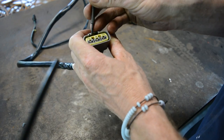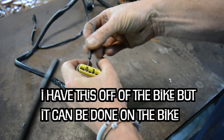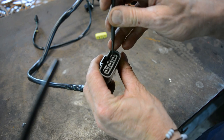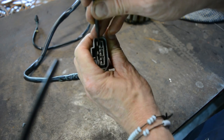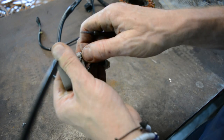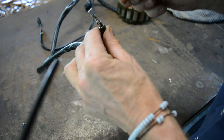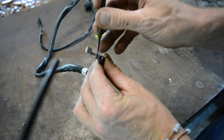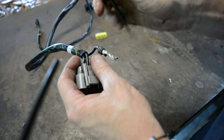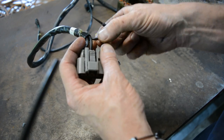What we need to do is get this little yellow bit out — just lever that up like that. You don't need to pull it right out but we're going to pull it right out anyway. Then we need to lift that little tag up and push down on the terminal and that will push it out, it'll come out like that. We need to get into that connector there and seal it up because the oil comes out of the wiring and leaks out here. These wires — I don't think it matters what order they're in in this plug, but it's a good idea to mark them just to be on the safe side.